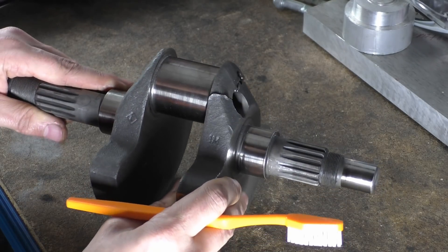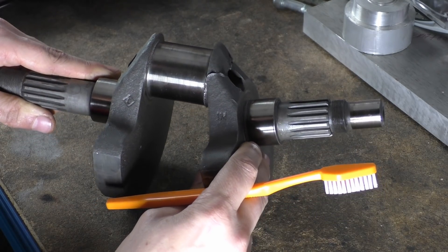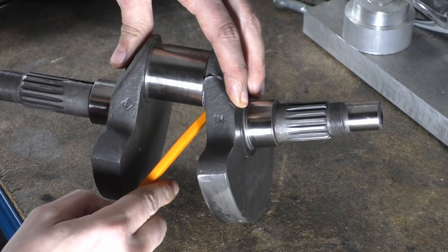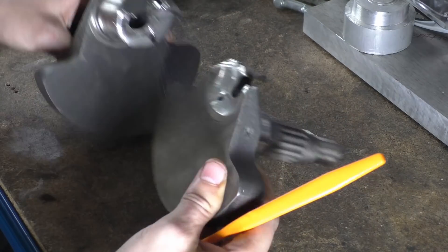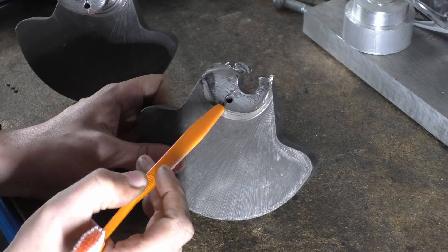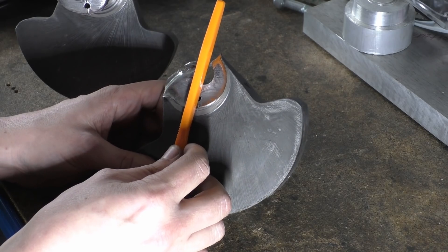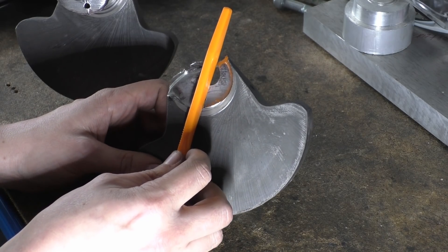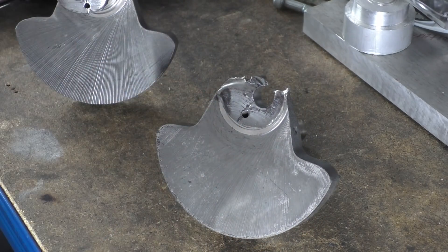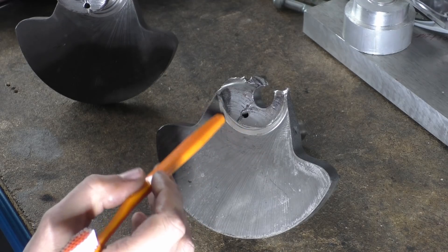As this has gone bang it's pushed the whole thing down, and this is where your strain is going to be the highest — right in here — and it's broken exactly there. When we look at the cross section, we can see that the hole and that line are actually at the angle at which peak pressure in your cylinder is achieved. There's not much they can do to alleviate this. You would have to make a bigger crank pin — though that makes the crankshaft heavier and you'd lose a bit of RPM — or move the hole position to make the cross-section more even.